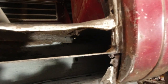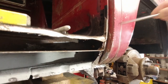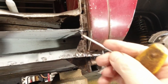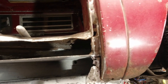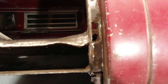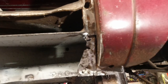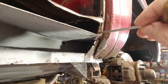Look, that weld there on the corner is a big weld, and it's put in from this side here. You can do it here, but this little piece has a crown on it. It's not a straight piece, to hold the rubber, and there's two other holes up here as well that we have to deal with. That's prone as well. To the best of my knowledge, the actual panel is cut out like that. You can see that is the actual shape on this panel, on the B post, but on the inside it's gone, so that needs repairing. So that'll be that whole piece, from about here on down to the top of the track plate.